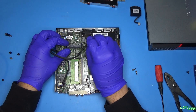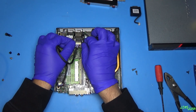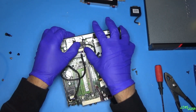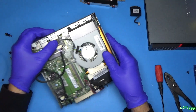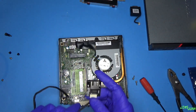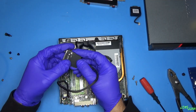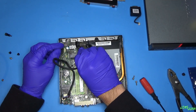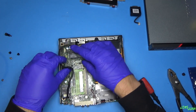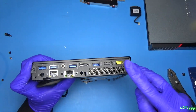So let's see, is this going to fit? I might have to put some tape down so it doesn't short out, if it even fits in here. I think that'll work. I'm just going to put some tape down, just because I don't want these contacts shorting out on anything. You can see I put some black electrical tape down there — ain't the prettiest thing in the world, but who's going to be seeing it? It's just a router. Just going to slide that in there. The question is, is this hard drive caddy going to work with it? I just want to see if it boots and detects it.